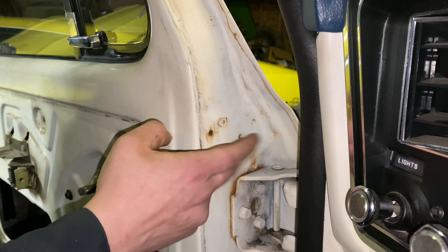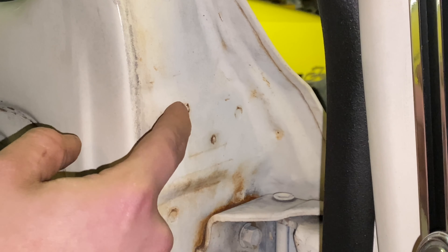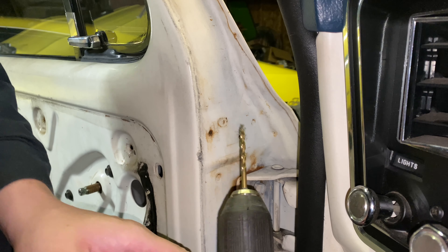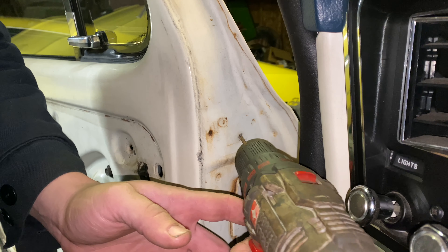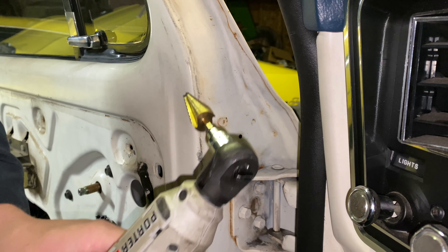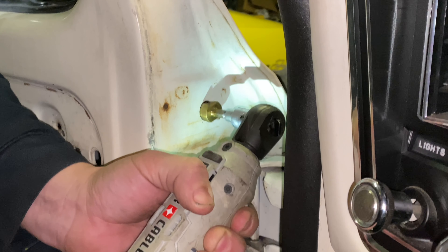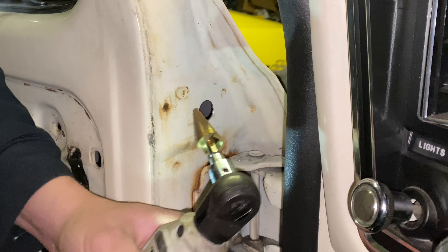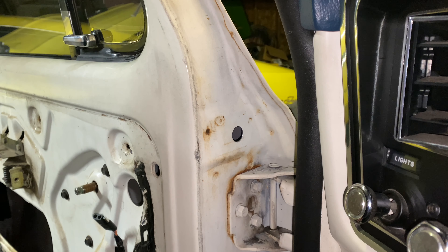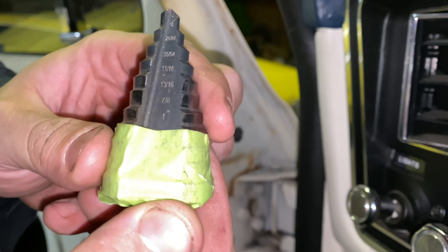Now we've got to drill a hole in the door here to run our factory harness through. The factory gives you an indentation right here in the center for the grommet — this is where the factory put it, so we're going to drill that indentation out. Not these — these are spot welds. Right here in the center you'll be able to feel the little indentation. I usually start with a regular drill bit like a quarter inch and drill it out, then use a step bit and bring it out to the proper size. If you have a 90-degree drill this will be better. I'll just use my ratchet with a step bit in the socket. This hole needs to be drawn out to a one inch size, so I'll go in from the inside of the door and finish bringing it out, then take a piece of tape and mark my one inch mark so I'll know where to stop.